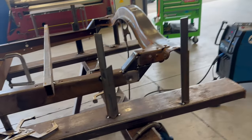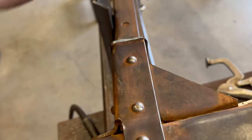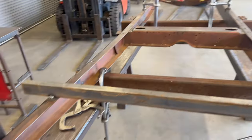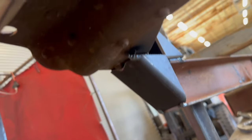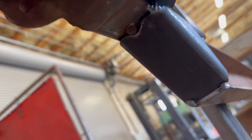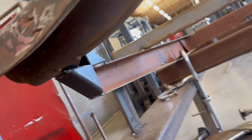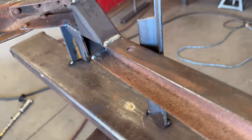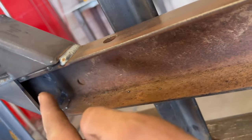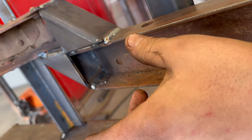This frame isn't quite two inches wide, but that's okay because I'm going to end up boxing the frame — I've already started up there, hopefully it transitions really clean. There's a little frame rivet right there; I had to notch out the tubing on both sides so I can get my pieces to sit flat. Little gap there to weld, little gap there to weld. Going ahead and welding her out. I'm purposely leaving that spot open because the box piece will fit in there nicely.